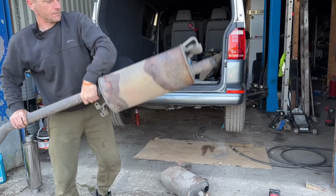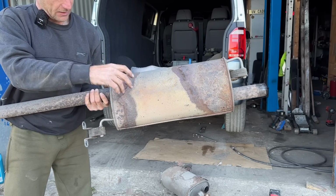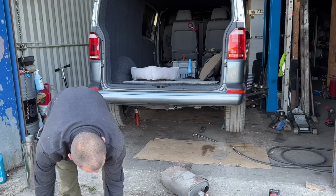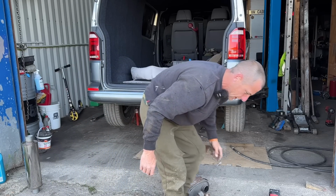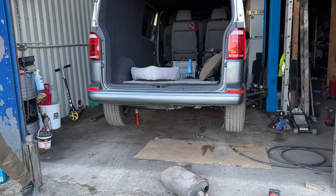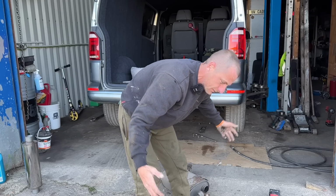First of all, there's the middle box. It's delaminating. To be honest, you could probably take the outer layer off and it'd still be good. Don't know, but it ain't straight pipe. Can you see? We've got stepped one, then one. So it goes through, it muffles up, it does all sorts. I bet you there's loads of black soot in this end. Yes. And there's hardly any this end. There's less on the end than that end.